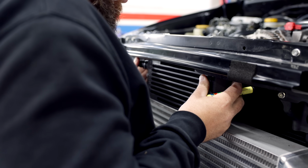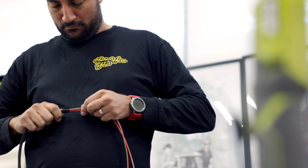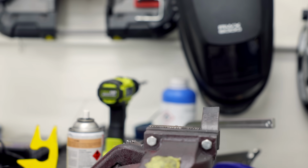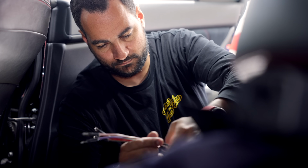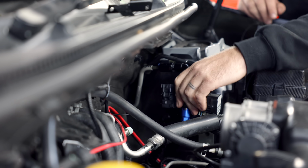While I make some brackets to mount the cooler on the bumper support panel, Al and Benny are making up custom -10 oil lines to connect the system together. We're also venting a catch can in the lower bumper area for whatever doesn't go back to the intake. These engines are known to breathe, so this is fairly important. Meanwhile, Dave is slowly picking away at the wiring, and while it's pretty fiddly stuff, we are actually making a heap of progress.